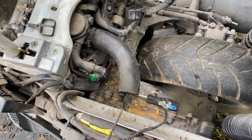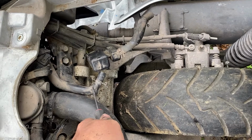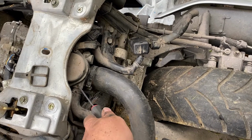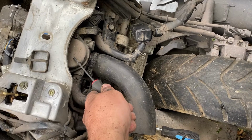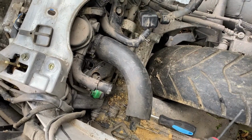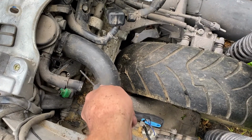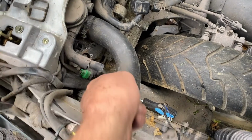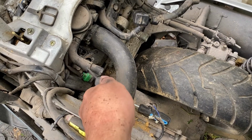That is it. So I believe I don't really need this hose. This one needs a breather. This one I do need because it's going to pull vacuum for the throttle body, which I haven't opened up. I'm just assuming that it's got a diaphragm in there that raises and closes based on pressures or the vacuum from the intake. So yeah, so that's where I'm at. So I'll need to get this hooked into this. Anyway, this guy can go in there. However, just for testing purposes, that should be fine.